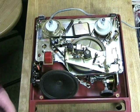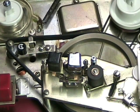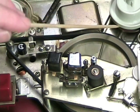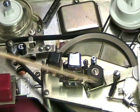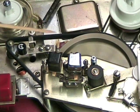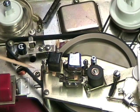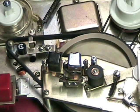Now let's look at how simple this is in principle of operation. As far as the capstan is concerned, there are only two actual moving parts: the motor, located just over here, and this thick belt. Then there is a secondary belt under here which rotates a plate that is part of the friction clutch mechanism for the take-up table. And that's it — there is no other strain on the capstan other than when it's engaged and the pinch roller is used.